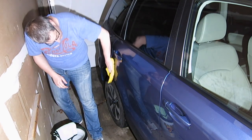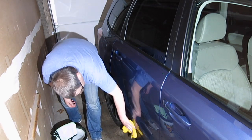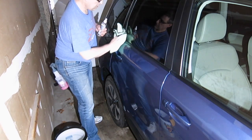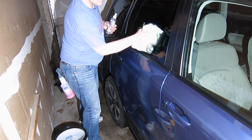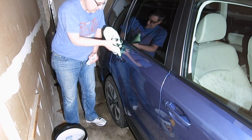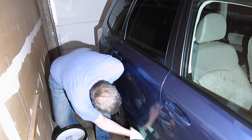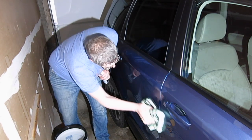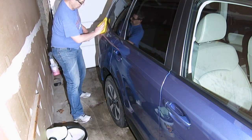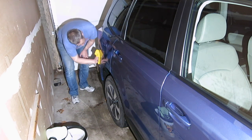And just use good common sense when you are washing a panel, like here, doing a back and forth, top to bottom. I like to always shoot a little further past a door panel with my washing media. And then when I come behind it with my drying towel, I stop at the edge of that door, so that I don't want my drying towel moving into territory that hasn't been washed, if that makes sense. I don't want to overrun the clean area. So if I was doing that back door, I would go 5 inches past the door with my yellow wash towel, and then when I come along with my drying towel, I would stop well short of that, right where the door ends. As you get around the car, you're going to hit every spot, but I just don't want to use my dry towel on a dirty surface of the car. I think that's just a sure way to cause some scratches and to get your drying towel really dirty.